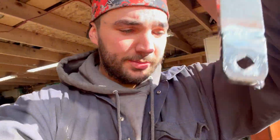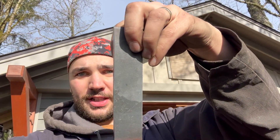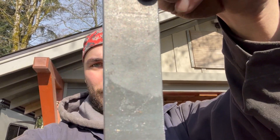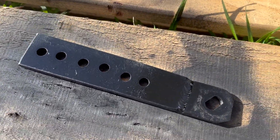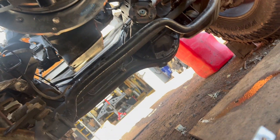We're going to bolt this to the side of the transmission and measure where four inches of stroke is in relation to this hole - how far from this hole - make a mark, and that will be where we drill a hole for our linkage. Once we have that, we'll make some linkage up and fine tune from there. This is my shifter linkage that goes on the transmission - it has lots of holes for ratio adjustment. I made a rod that also has a bunch of holes so I can adjust the ratio and dial this thing in.